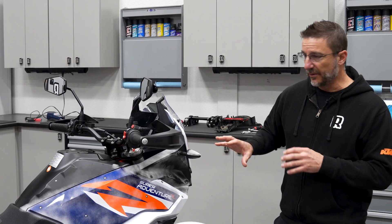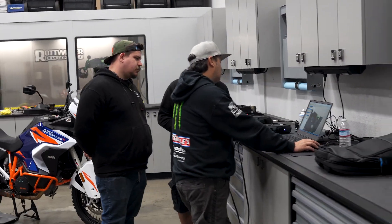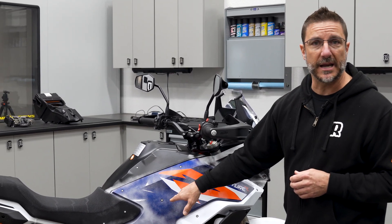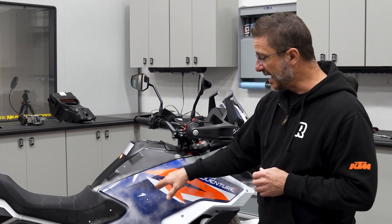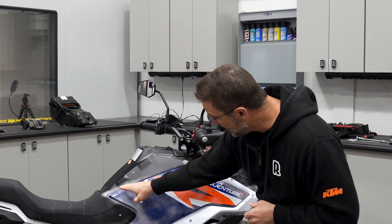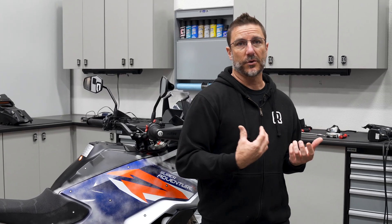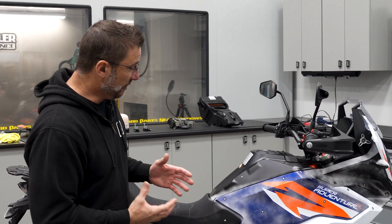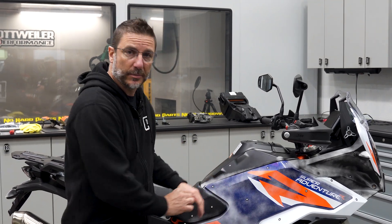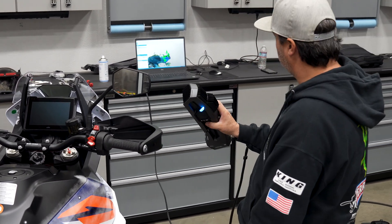So we've got this brand new 2022 KTM Adventure R and we have a few parts in mind that we're going to design. The first thing we're doing is designing a clear bra, because this bike has very expensive painted plastic on the side. A lot of people's knees are going to be grinding dirt and debris right into that tank, and when they buy a brand new $22,000 model, they really don't want to grind dirt into their paint. So we're going to design a clear bra that we can laser cut in house and send out to customers. We've chosen to do it by 3D scanning it — we've done things where we put blue tape on the bike, draw Sharpie on the tape, scan it one-to-one, and turn that into a DXF file using a raster image. But since Craig's here with the scanner, we've chosen to scan it and pull the 2D DXF out of that scan.